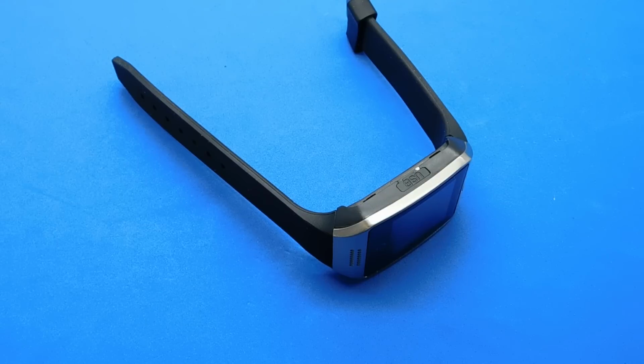To get an Android based watch, expect to pay a minimum of £50 to £60, but that will be a basic laggy watch. Expect to pay £100 for a smooth operating Android watch. Because running Android Smart Wear, you need a big amount of storage and processing power. A quad-core processor is a minimum, really. So more memory will make the watch run a lot smoother. This watch is laggy because of the slow processor.